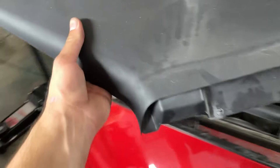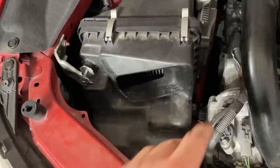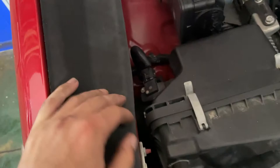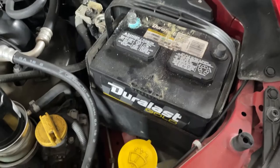The first thing to do is remove this intake duct and set it aside. Next, remove this bolt here which releases the air box, and then another bolt down here. With those bolts removed, we can wiggle the intake box out of its position. We also need to remove the MAF sensor - just unplug it and then remove the box out of the car.